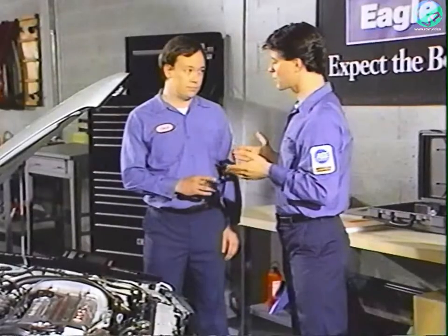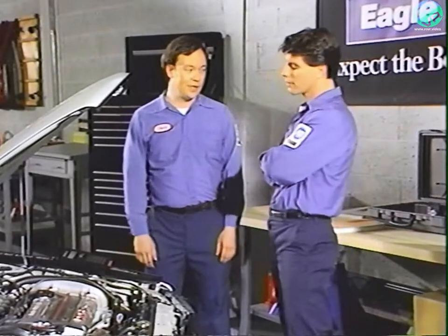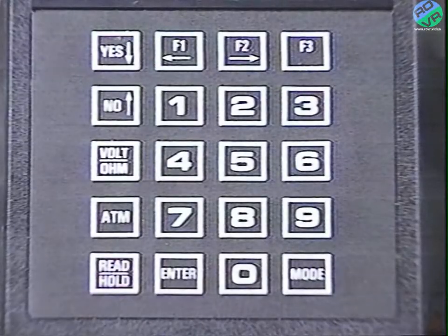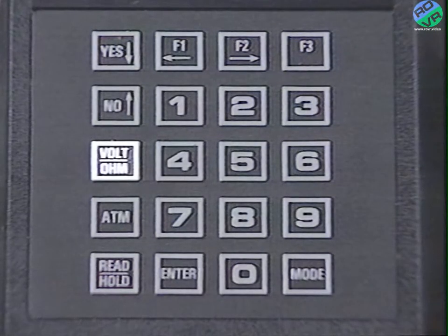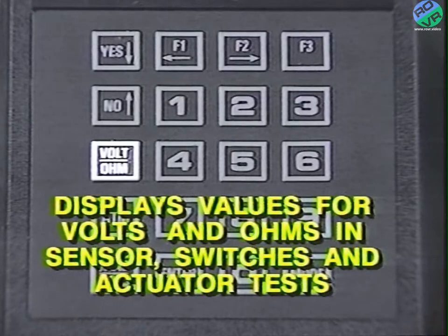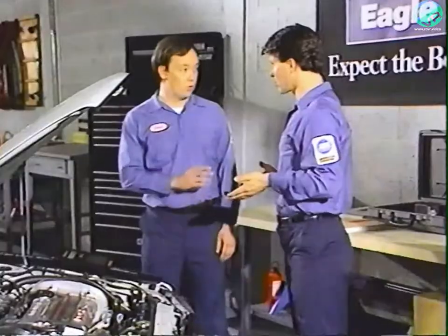You don't press enter to make a choice. The volt-ohm key can be used any time you're in one of the select group tests — sensor tests, switches tests, and actuator tests. When pressed, the DRB2 will act as a meter, displaying values in volts, ohms, or even an overrange reading, meaning the resistance is higher than what the ohmmeter can measure.